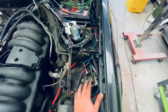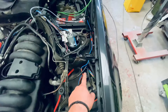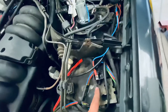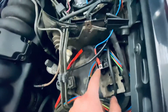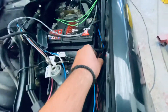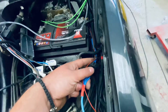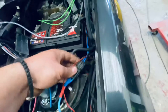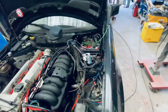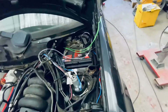The W124 has this block on the side. This area has a 12-volt supply — when the key is turned to ignition it does not have power on accessory, just on ignition. I use that to get power from here to a plug: one side goes to the MegaSquirt, another side goes to the injectors, and the third wire goes to the AFR wideband controller that sits inside the car.